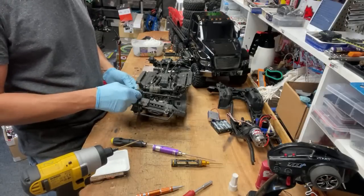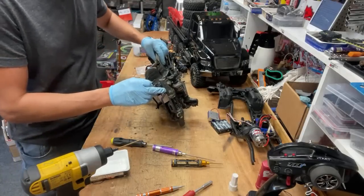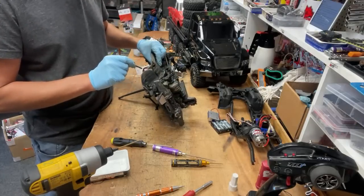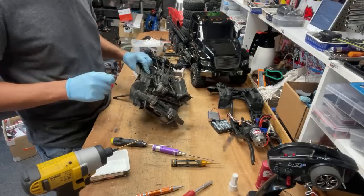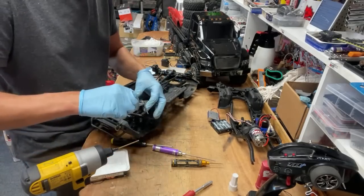Right, so that has got a broken drive shaft in there, so that is out. So you've got to pop that shaft out of there. And, oh, I've forgotten, but there is actually an O-ring in there to keep the water out. So we're going to have to assemble that again slightly differently. Right, remember that. Right, next, this side's got to come off.